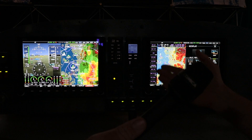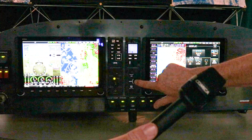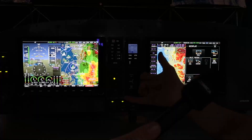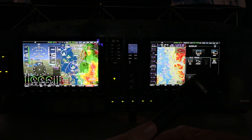There are other ways we make it even simpler. Let's say you're going along and you want to set your barometric pressure — you could listen to the radio and find the right airport and get the frequency, or you can reach over here to BARO, hold that button in, and it has the database. It will find the nearest airport that has AWOS or ASOS, grab that data, and update your BARO number just by holding that button en route. We try to make the user interface as intuitive and quick as possible.